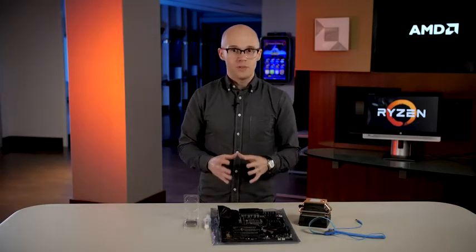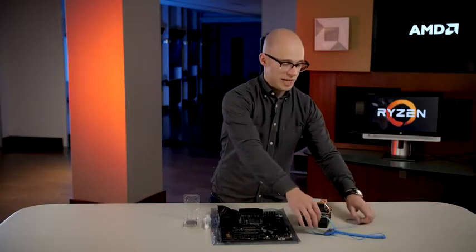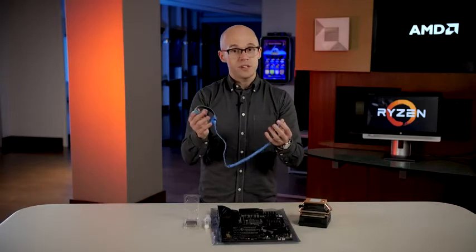The first thing that you have to know is that electrostatic discharge, or the little zaps that you build up by shuffling around on carpet, can actually be dangerous for the sensitive electronic components in a CPU. Don't build a computer on a carpet or a rug — hardwood floors or even tile floors would be best.